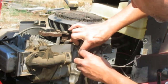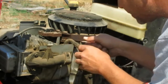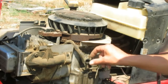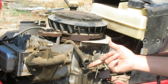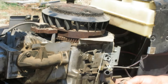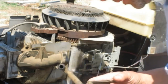Here's that PCV valve hose I was talking about earlier. I'll see if I have something to replace it — it doesn't look like it's able to come out of there very easily. This is in pretty bad shape and I'm not sure if it's going to cause any running issues — that may have even been the whole problem. I went and looked but couldn't find anything that remotely came close, so I just wrapped electrical tape around it, clamped it back on, and that'll be a temporary fix until we get a proper replacement.